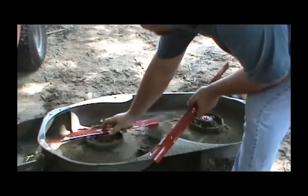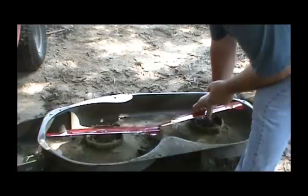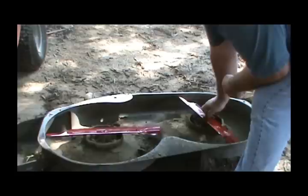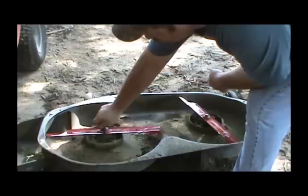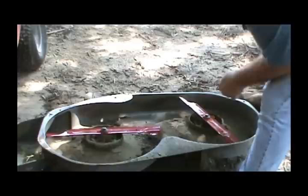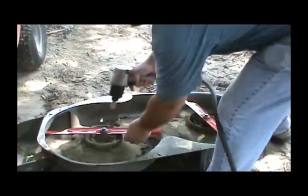As you can see I've hit something pretty hard right there. If you put them in like this you can see they're not going to interfere, so it really doesn't matter what position you put them in. I always put one one way and one the other. You want to make sure it's very well seated. Here's where you get in trouble if you're just doing it jacked up in the air — sometimes these things will get loose and you'll force it down on that star and actually deform that spindle star, and then you'll have issues and have to replace the spindles. I know from experience.